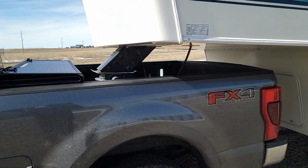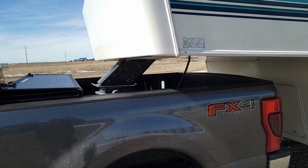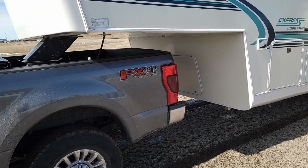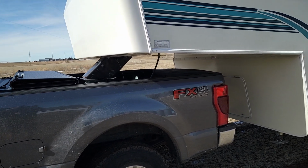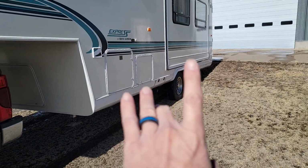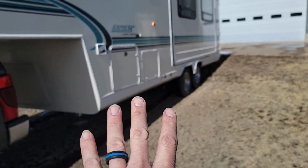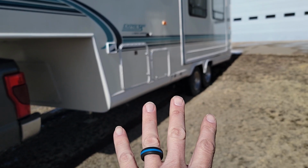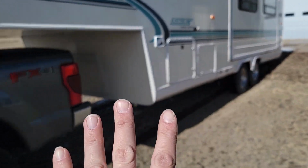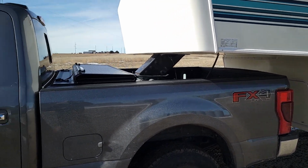Now if you want to be a trucker, go get a CDL and slam docks all day like I did for a while. And you can jackknife everything that you have to, because that has to. There is no reason, most sites are pull through, most sites are angled, that you need to jackknife this trailer. You're gonna crush your cab, you're gonna damage your suspension. You may not see it initially, but you will damage it. Your tires are also pretty weak, and that destroys tires. Go and look at a semi that I've slammed docks for about 6 months on, and the trailer tires are bald because you're tearing them up. So please, there is no reason you need to 90-degree turn a pickup and a fifth wheel.